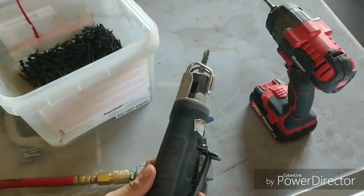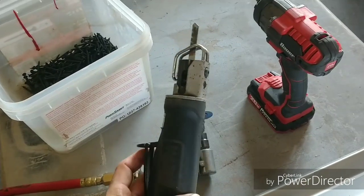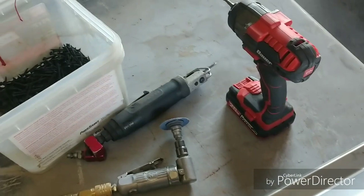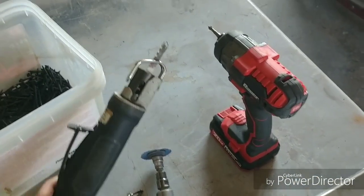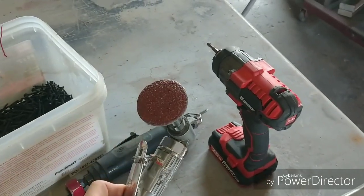In order to put the structure in there, we got to start doing some grinding and some actual repair. Some tools you're going to need is this air saw. I tend to only like to use these air saws, but you don't have to. You can use a normal plug-in-the-wall jigsaw, and that'll be perfectly fine, because these are just mini jigsaw blades. And then a little grinding disc.